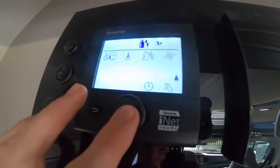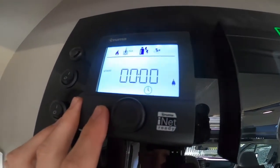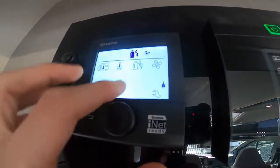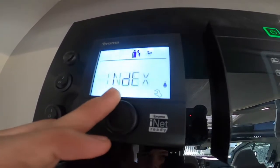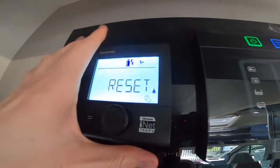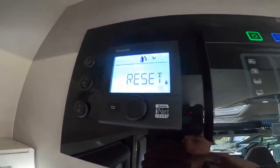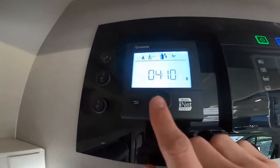At the bottom you can set a timer for the heating to start and finish, but you can only do that once the clock is set on the display panel. Should you get a warning triangle in the middle, go to the spanner in the bottom right hand corner, go to preset, press enter, it'll say reset, and it will completely turn the panel off and restart the system — so you'll have to set the temperature, water, fuel and fan all again. To turn off, just press and hold.